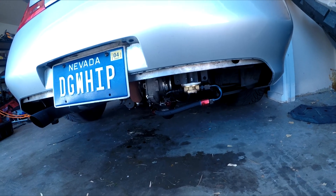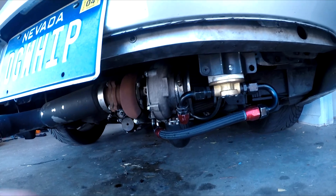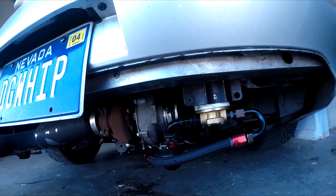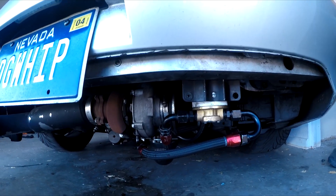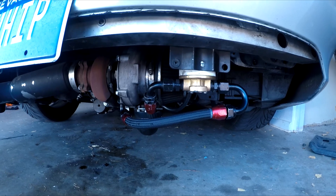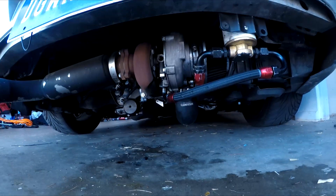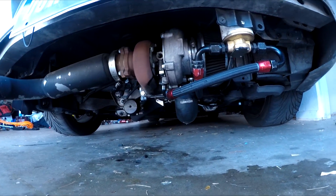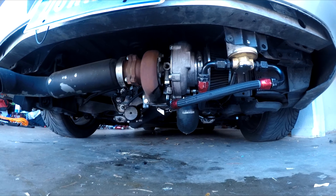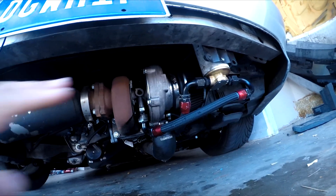Getting this perfect takes a while — you really have to plan everything. If you're going to do this, I definitely recommend sitting the turbo up a little higher and trying to get the scavenge pump below the drain if possible, so it can gravity-feed into the drain. Mine is pretty much parallel with the drain, which I guess is good enough for my situation. Ideally you want it to gravity drain into the pump. I understand if your turbo is like a foot off the ground that can be hard, but you do what you gotta do.